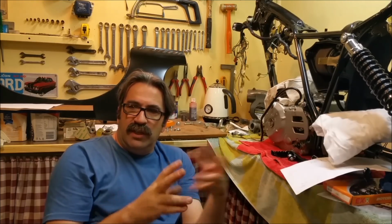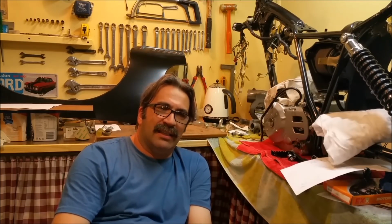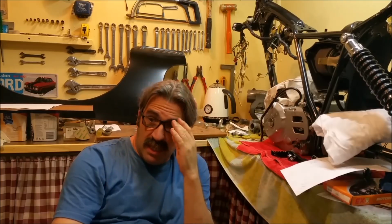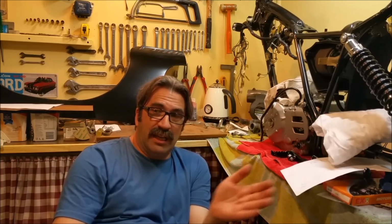The other thing is, I left the other video on a negative note with the MG, and the fact that I misdiagnosed the rear main oil seal. We thought it was the gasket from the gearbox, and it turned out to be the oil pressure line for the gauge. It still is great that the engine came out, because the gearbox was leaking at the front gasket, and the ring gear was absolutely screwed, so it needed a new ring gear. And there was another reason why we wanted to take it out. The spigot bush was fractured and had all fallen apart, so it needed all those components anyway, and it also gave us a chance to clean it up. So I might have come off as a bit negative with that, but I'm truly grateful that Dave took it out and I managed to get all that work done.